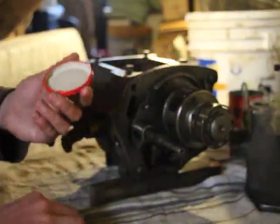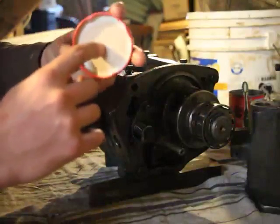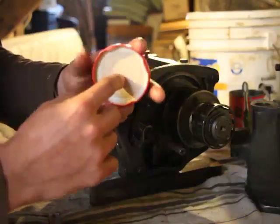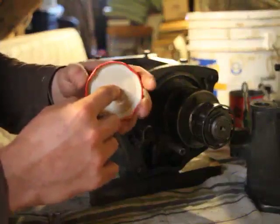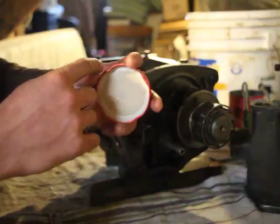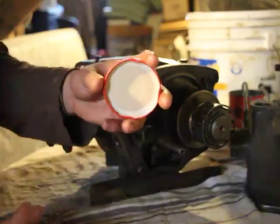Okay. So now the thing is, with the grinder, as I was saying, let's say this is a grinding wheel here, and it's turning like that. If I put my hand at the very center, regardless of the speed, it's going to seem that it's moving very slowly, and at the center it actually is moving very slowly. In fact, mathematically, at the very center it has a velocity of 0. But if I put my hand at the outer edge, it's still turning at the same speed. Remember, we haven't changed the speed. Imagine there's the motor here, and the grinder is connected here.